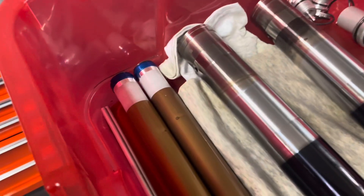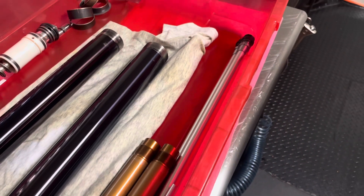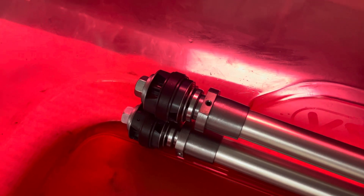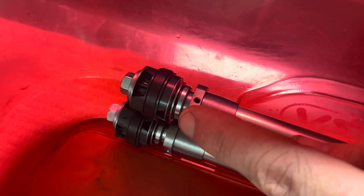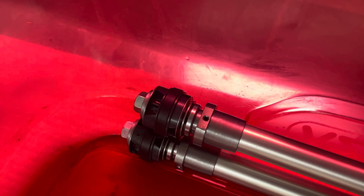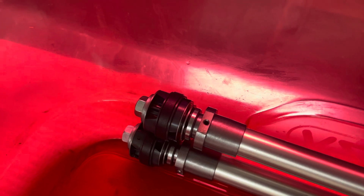The cartridges have been mostly disassembled. The upper cartridge tank — the piece that's normally up here that is typically silver — has been removed and sent off to be anodized as well. Here are our mid-valve assemblies. These are all stock and haven't been modified yet. We'll modify these to our JBI spec — part of that is changing the mid-valve part to a leaf spring style mid-valve. Complete details on ridejbi.com explain exactly what the leaf spring mid-valve is, what it looks like, how it works, and why we use it.